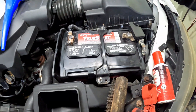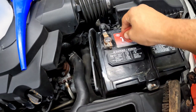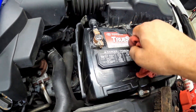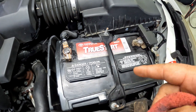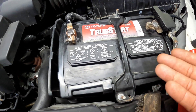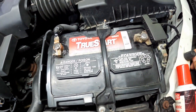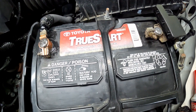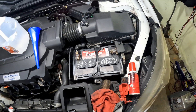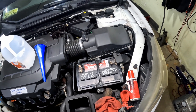Make sure those caps are all the way down, and that's it — that's how you add distilled water to your battery. Just make sure your terminals are clean. Doing this keeps your battery working efficiently and lasting longer. I'd recommend getting this checked every oil change. If your shop won't do it, you can do it yourself — just pop these caps off, make sure the water level is above those plates, and your battery will last as long as it can. If you enjoyed the video, like, share, comment, and subscribe to the channel.